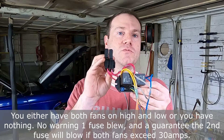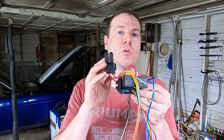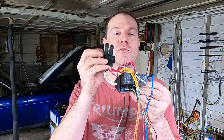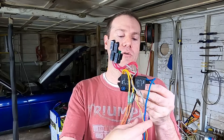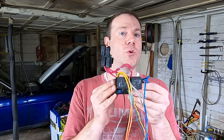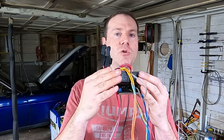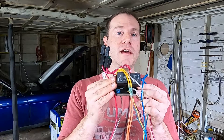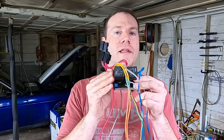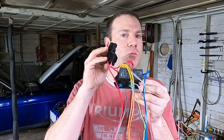The 14-gauge wire is fine for running one fan on high speed constantly for about a five-foot wire run, but that's what you're running from the battery to the fuse panel, all the way through the controller and down through the power wires to the motor. The total length can be five feet or more, and you're really pushing it for 14-gauge wire. The relays are high and low speed, so if you lose one relay, you'll have both fans operating on either low speed or high speed. I really wish it had been set up for fan one and fan two instead.